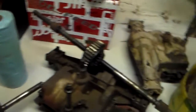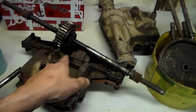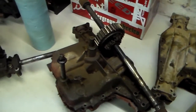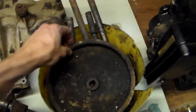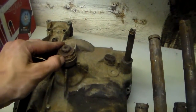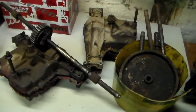That's how I wanted the Craftsman's. Now we got a pair of Spicers. This is the one that came out of the mud mower when I blew the axle out. The guts have something wrong with them, because when it blew the axle it blew the weld on the rear end and shot stuff into the gears and screwed something up. I got a fresh axle here that's welded, never been in anything since it was welded — it's ready to go. I got this case given to me and this bucket full of parts. This was a good transmission but the reverse chain blew out and the upper gear wouldn't come off, so that's FUBAR. But between these two transmissions I can piece one together and make one good Spicer, which is what I run in my mud mower.